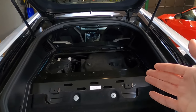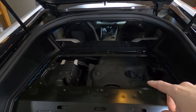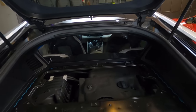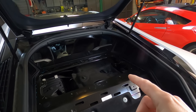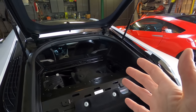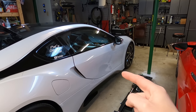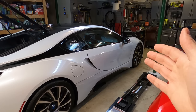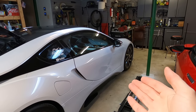I have the lid off the engine compartment here and we can actually see this is the top of the engine. This is the acoustic cover to help keep noise down, and underneath there is our valve cover, our head, and eventually our block. If we look straight through to the front of the car, this is actually the high point compared to the radiator and the coolant bottle up front. A few folks said that if you raise the front of the car so that part becomes the high point and this becomes more of a low point, you can get some of those air bubbles out of the top of this engine and flowing forward. In fact, there were a couple of BMW i8 technicians that replied to my video and said that's exactly what they had to do — they put lift forks at the front of the car, tipped it up high enough to raise the front, and then performed the bleeding procedure. It did still require multiple attempts, but that worked for several people. So when Sam does his bleeding, I recommend that he actually elevate the car.